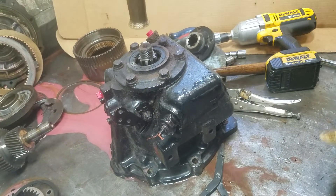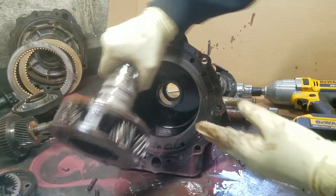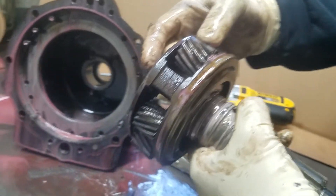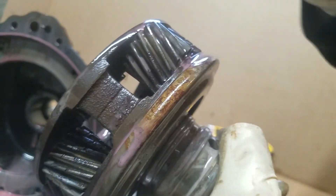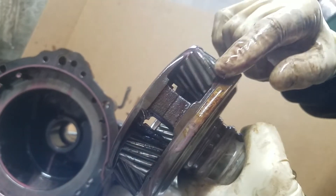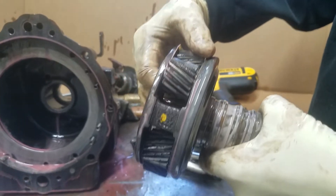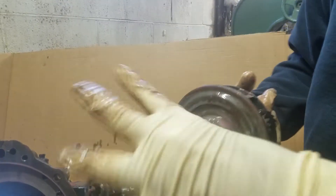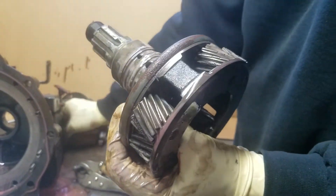When in doubt, get a bigger hammer — works every time. Here's our planetary. You can see we've had a little bit of water. The gears on this are starting to wear and rust away. This is only used in reverse so it doesn't see much use, but you still want nice clean gears. You're looking for side-to-side movement — I don't see any, so the planetary is tight. You're looking to see that the bushings are there and haven't spun, and then looking at the sealing ring surface to make sure that's in decent shape.